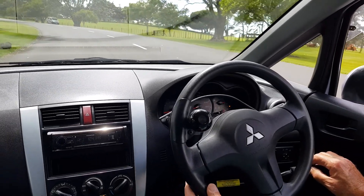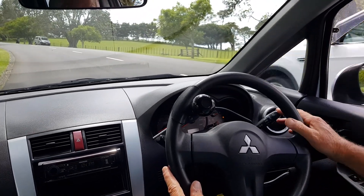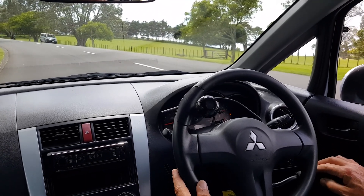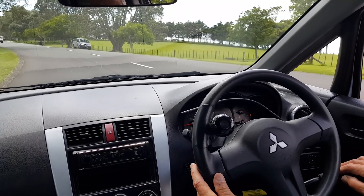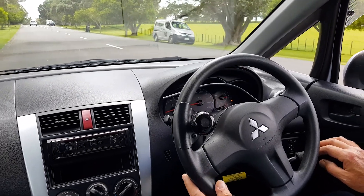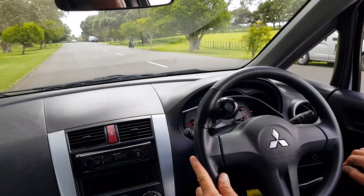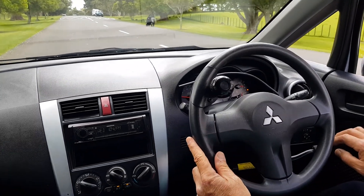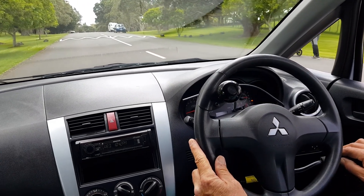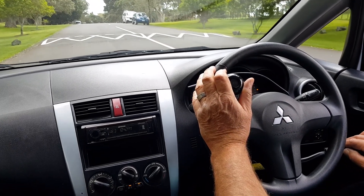In this case I will pull over because there's a vehicle behind me, cancel the indicator, and accelerate slowly. Not a lot of pressure on the handle — you don't need it — and moving nice and gently. To demonstrate what will happen if I put too much pressure on there, the car will take off. We don't need that. Slight pressure to slow me down, and that really is it — that's how you operate a hand control brake.